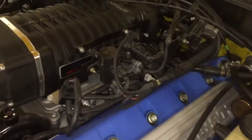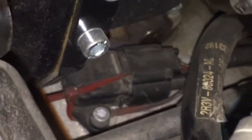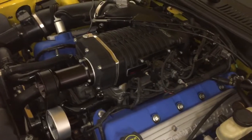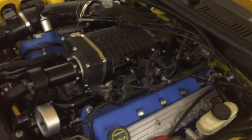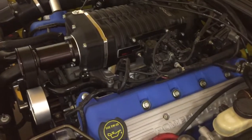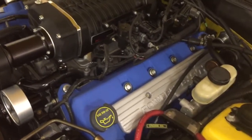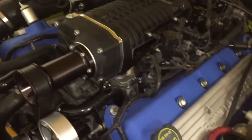Here's a piece that's somewhat difficult to find — right there, that's the IAT2, the secondary air intake temperature sensor. It's one thing to know the temperature of the air as it enters the intake, but after it's been compressed by the supercharger, that's called the charge temperature, and the car really needs to know that so it can pull timing and run safely. This secondary sensor measures that charge temperature — that's its most important function.